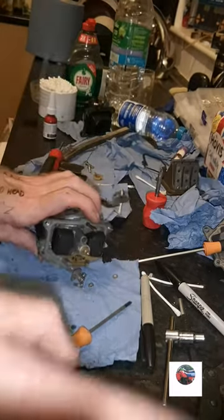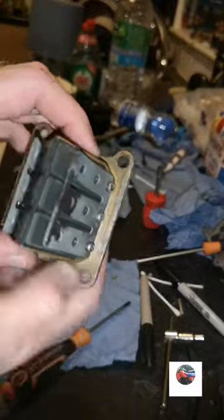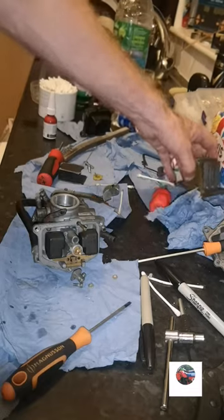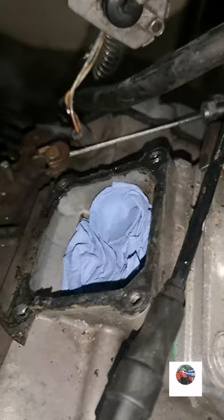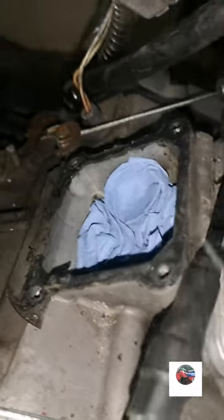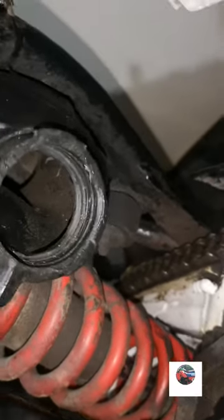We'll go and take the gasket off there, where the reed case fits in on the engine, off that bit, because it's still on. So we'll go and do that now. So just put plenty of tissue in there so nothing can drop in the bottom end. And then we'll scrape this gasket off here. And then we'll look in there, look. We'll have to clean in there.